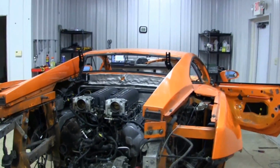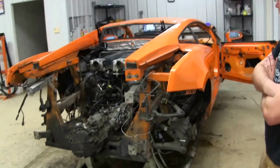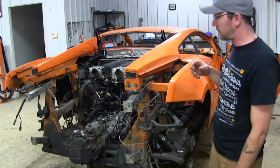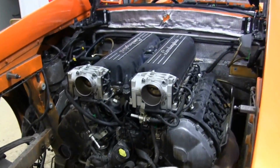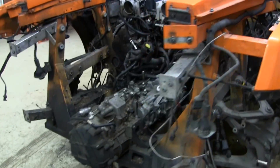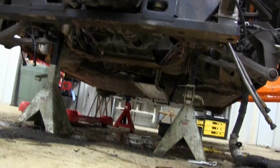Okay. Engine, have you seen anything interesting that'll make it a little challenging for rally as far as service goes, or maybe intake location or anything? Like, what are we looking at here? The air intakes are all up here that feed the air boxes under the hood, so you have to worry about a lot of water and a lot of overhead dust for any issues there. As far as service goes, there's nothing really that's easily serviceable on this motor besides coils. Everything else is rather challenging to get to with this assembly. Let's see what else we got here. Underneath, the dry sump system is all tucked up underneath the frame rail, so you don't think you'll run into any problems hitting anything there, especially with a carbon fiber aluminum skid plate underneath.